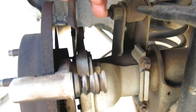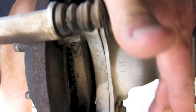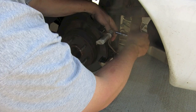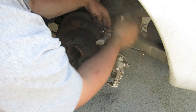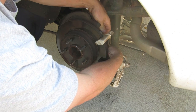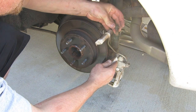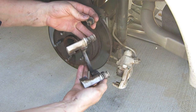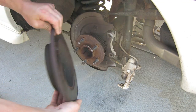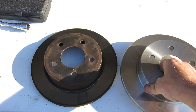Now we need to take the brake caliper bracket off — there's a top bolt and a bottom bolt, and you'll have easy access to use a socket wrench on both. Just take the socket wrench and break those bolts free. They're not too bad. Take out those short two-inch bolts and the caliper bracket will just come right off. We can clean that up before we put it back on. Then grab the rotor with both hands and pull it straight off — it'll slide right off. Here's the old rotor; it's not too bad, but we're going to replace it with a brand new one.